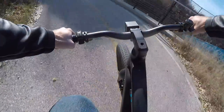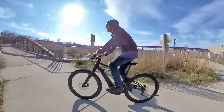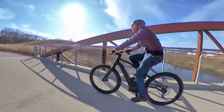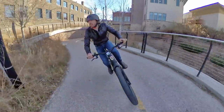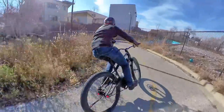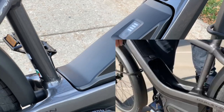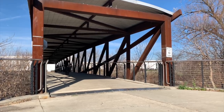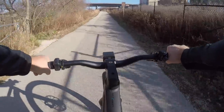These e-bikes take motorcycle-level design considerations for precision, safety, and comfort to build higher quality e-bike frames that still remain light and nimble. Speaking of nimble, let's talk about the ride — these bikes are just so much fun to ride. The single-speed Mosh is nicely geared to start strong and yet not require too fast a pedal cadence at top speed. The way Serial One centralized the mass of the motor and the battery as low as possible in the frame means the bikes just love cornering, plus they've got those Schwalbe Supermoto X tires that love leaning into turns. The Brose motor offers four different assist levels and gets quite powerful at the top end, offering up to 90 newton meters of torque. There are two different batteries, either a 529 or 706 watt-hour battery, rated for ranges of anywhere from 35 to 100 miles or around 60 to 160 kilometers, depending on the bike's pedal assist levels.